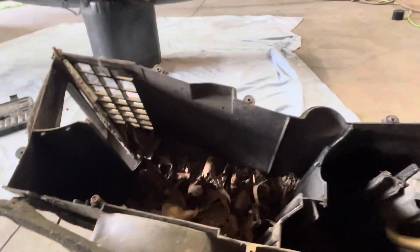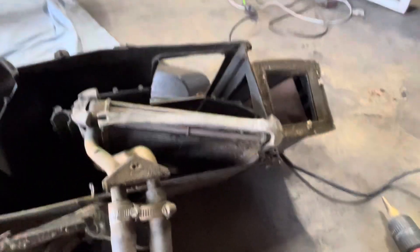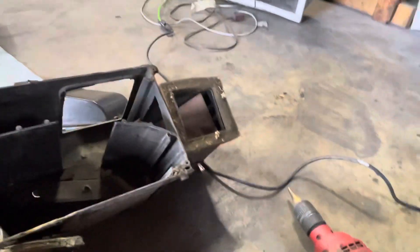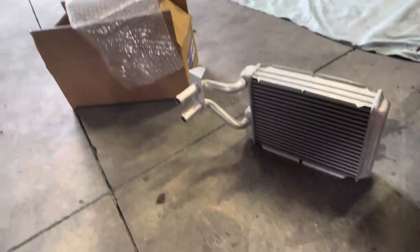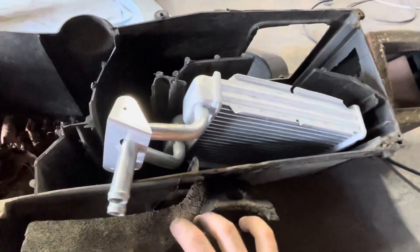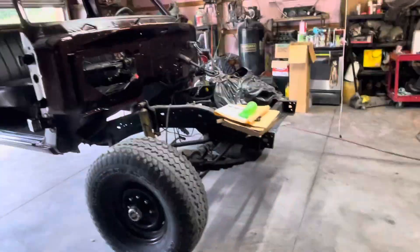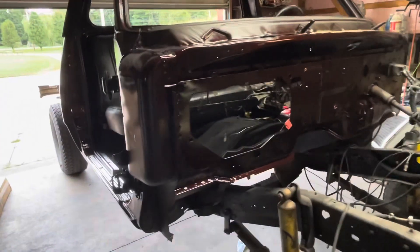I'm working on getting this heater box — it has the heater core and the blower motor on it. It had AC in it but we aren't going to be using that. It doesn't get too hot where I live and it probably needed a lot of work. We're trying to get this heater core out — this is the old one, and I think someone's cut this out before to put that one in. The new one is shaped a little differently, so I'm going to see if it'll work. That looks a lot better — that's the correct heater core now. Picked that up today from O'Reilly's. We're going to clean this box up, throw that in, and then throw that into the truck.